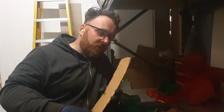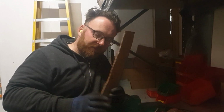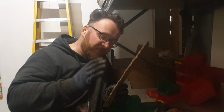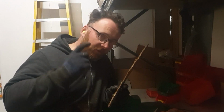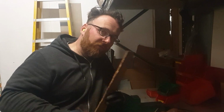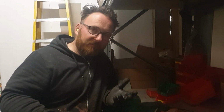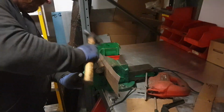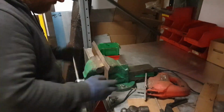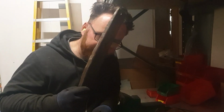Using this template though, we're going to cut out some excess, roughly in the shape of this, and start shaping it, because what the template will give us is the bend lines, and our repair panel will have a 90-degree bend on each side and will fit onto this chassis leg, providing more strength. Again, I've done this more or less off camera, but you can see on the screen now me hammering, swearing, hoping for the best to produce this.